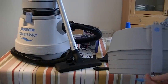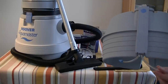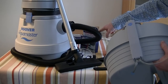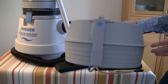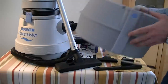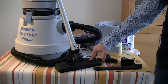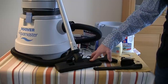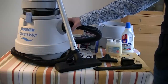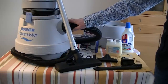Here's the clean water tank. Unlike the Vax system which had a tank that fitted inside, this fits on top of the motor unit. So basically when I do the demonstration, I'm going to put one sachet of the solution into here, fill it up with warm water, and pop it on the top of the cleaner. This blue end goes into a little blue hole on the body of the machine, and this part goes into a little connection on the collar of the hose, so that feeds the solution through the hose to the nozzle. The advantage of that is the machine, when you're using it as a dry cleaner, is quite light - it was lighter than the Vax equivalent at the time and it was more powerful.